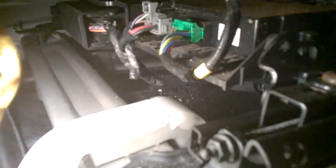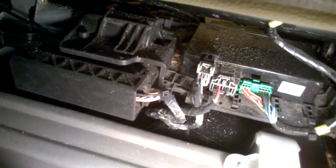This is the whole carpet from just the left side of the car. The center armrest and other pieces just slide underneath, so nothing is attached there. Now doing the same on the right side. Pay attention to those wires and how they are fitted before removing the carpet — some of these are part of the SRS system for the seat belt, which is really important. Make sure you don't disconnect anything, protect those wires, and when pulling the carpet make sure you don't grab any wire.